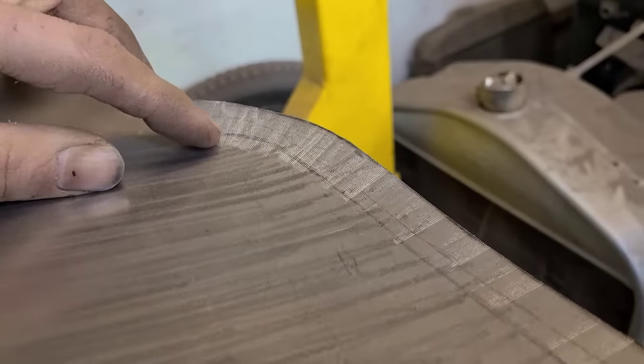Okay, well, I made two rocker panels, or whatever these are called. I don't know. So I had to go back and tune it up and whatever. And I did have to do a little more shrinking along this edge. But our pre-shrinking worked out pretty well for this corner. I didn't have to, because if that hadn't worked, I would have had to cut this out and then just put a piece of metal in and then weld it along the seam here. But we were able to make it all in one piece, so that's really good. And now that we got these made, it's pretty simple, didn't take very long at all.